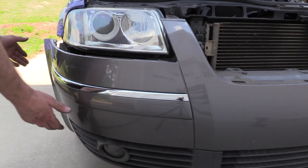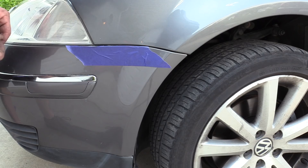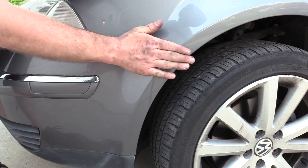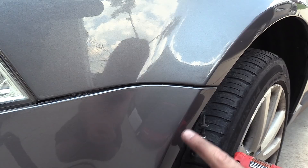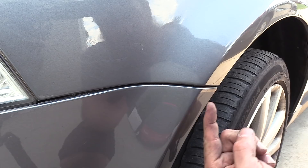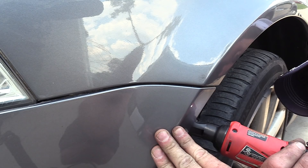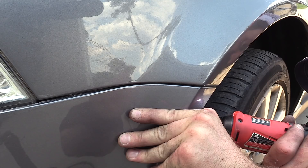From here, we can go ahead and take all of our tape off so we can get a good look at our alignments. This is going to come pretty close — a nice even gap all across the bumper and between the bumper and the fender. If there's too big of a gap where the bumper sticks out, the screw that comes up from the bumper into the fender is the key. Start the screw, then manipulate it as needed. And now we've got basically a perfect alignment on the fender and bumper.